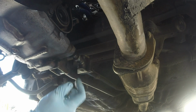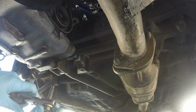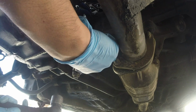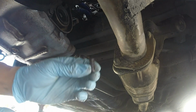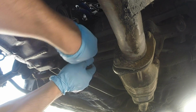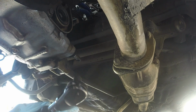And you're going to need to get the little pin removed. I use this bolt, which always makes it easy for me. You can tell I've used it numerous times. Line it up with my pliers. That pin looks just like this. That'll let you remove the top portion. And the other part of the linkage is just a 12mm bolt.